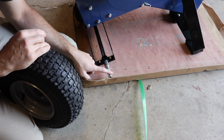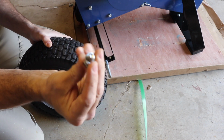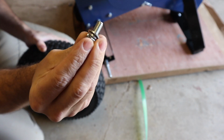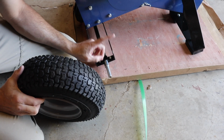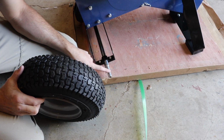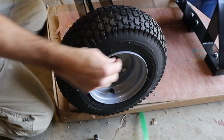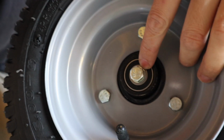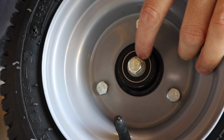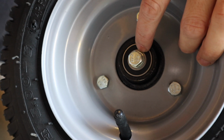All right, time to get the tires on the axles. So obviously stem outwards, and we've got this 13 mil bolt with 2 washers on it, a lock washer and a regular washer. You're gonna have to use some force to rock this up. It's pretty heavy, so you might need another set of hands to get these on. Just slide it on, tighten the bolt down. So in my opinion, this tiny little washer here, that's all that's holding on this tire, is not wide enough. So if you want to buy another washer that's wider, I'd probably recommend doing that.